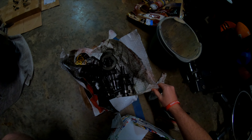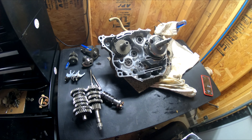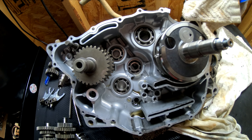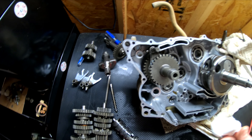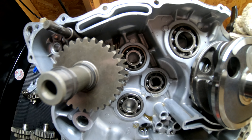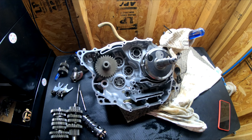This is gonna be a fun part. I'm not gonna record most of me rebuilding this motor because it's gonna take me a long time. I'm having to read the manual and watch videos. I got most of the transmission gears out. I cut myself within two minutes of doing it. This JB Weld got inside of the case and I was peeling it off — it was really hard and it sliced me right open in a terrible spot because every time I bend my finger it reopens. I'm gonna clear all that JB Weld out because we don't want that in there. I guarantee that's probably why the transmission gear broke — the JB Weld got in there, something broke off, and got in between the gears.